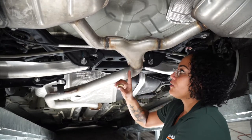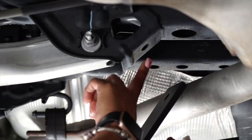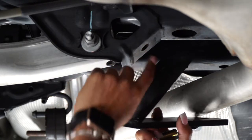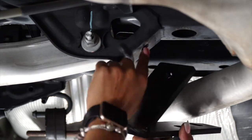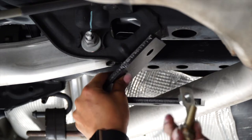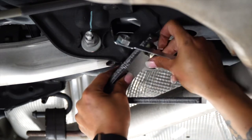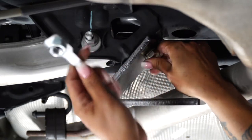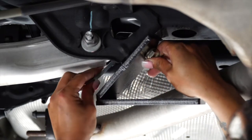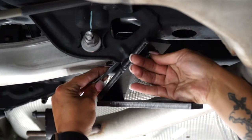We're going to follow the rear muffler all the way to the back axle and mount the bolt-on bracket to the suspension housing. Make sure the hole here is aligned with the hole on the suspension. Take your bolt and lock washer, pull it through, then take your hand nut, place it on the bottom, and give it a few turns just to secure.